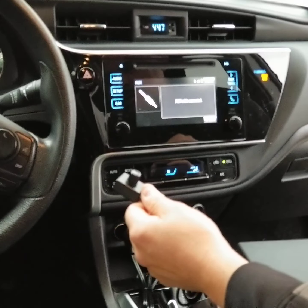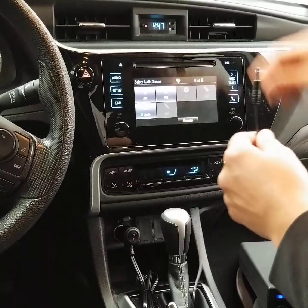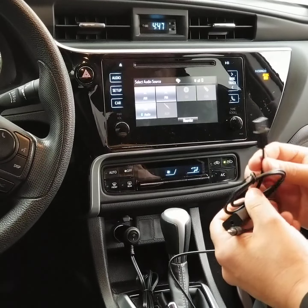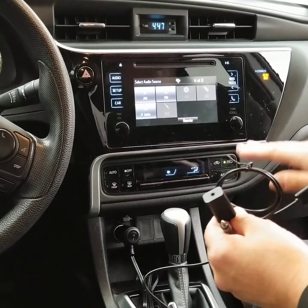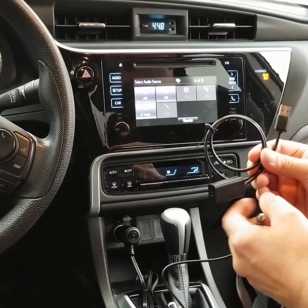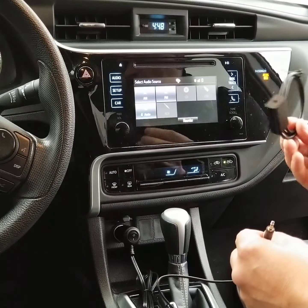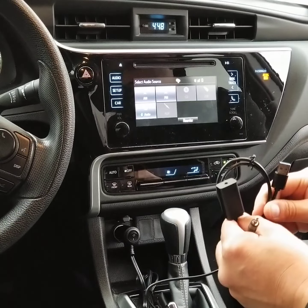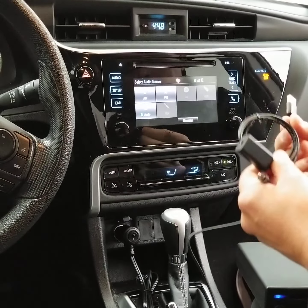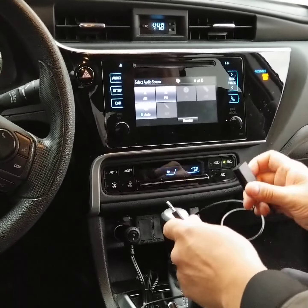I stated I would demonstrate what to do if an auxiliary input is not present, so I'll disconnect it — we've lost audio as expected. I'm going to take the auxiliary input generator, which is designed for newer vehicles with nice sound systems where everything is strictly USB: smartphones, charging, music sticks, but no auxiliary input. The manufacturer provides this in the deluxe kit. This moves us to option three. This little cable is actually a smart device that makes the radio think you're plugging in a smart peripheral component, opening up the audio port for the USB connector, then converting it to an analog audio input — very intuitive.